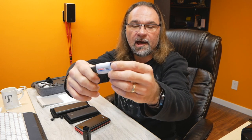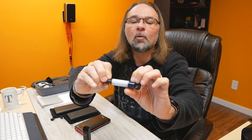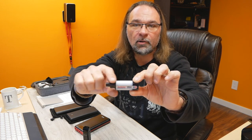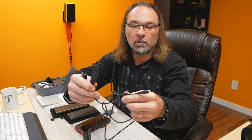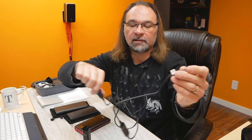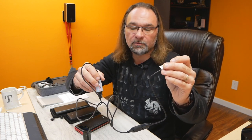On the back of the Optimate adapter you have a USB port. It's 1000 milliamps, has a blue light indication when plugged in and powered, and comes with extra cables including Type-C and Lightning adapters. I plug that into this port and route the cable into the side of my left pannier to charge all my battery banks while I'm riding — a great tip if you want to use that port for more than just storage charging.